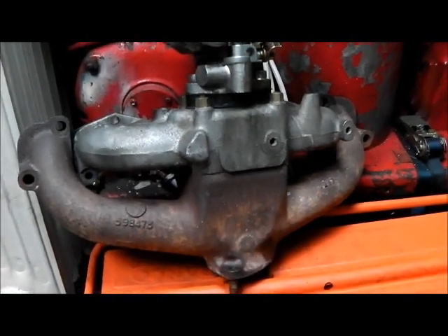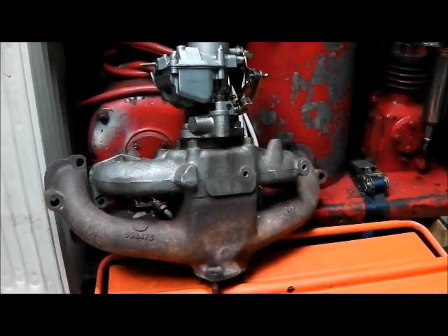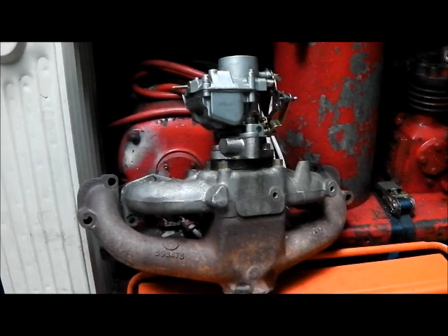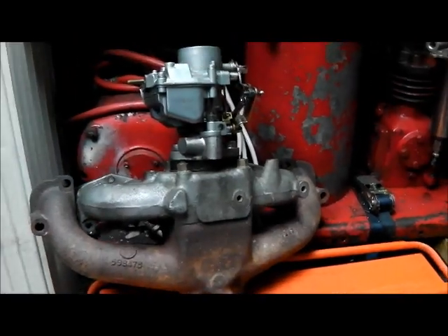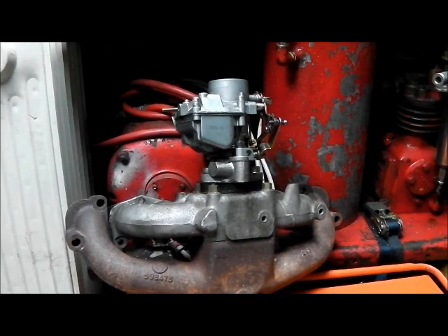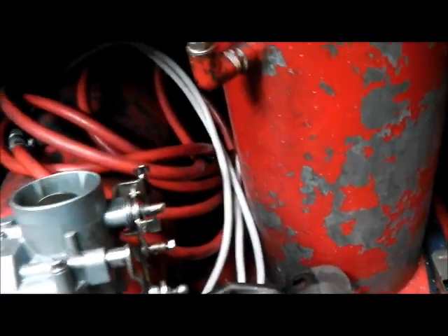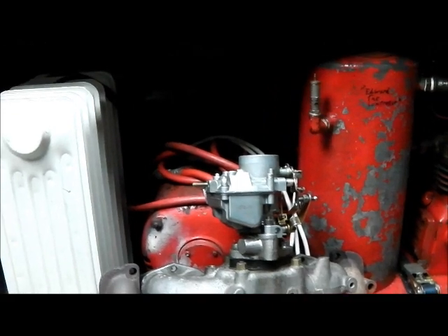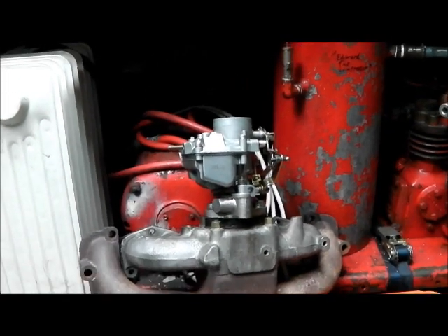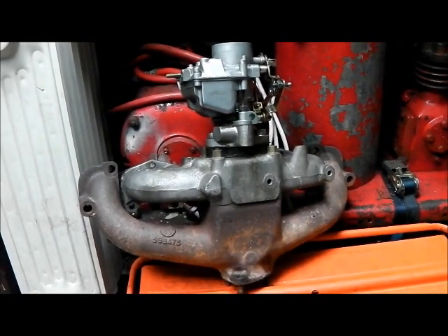Definitely an improvement. Not having the hot spot on the manifold is great. It's going to need the heating line plumbed in because you could see condensation on the outside, so in cold weather that will be an issue — I shall get on and do that next week. Otherwise I'm very impressed. The only difficult bit was the throttle mechanism — there are a few bits you have to cut and alter positions of, and it could do with better diagrams supplied. The choke cable wasn't long enough so I'll have to sort that, and I had to change the vacuum line. But yeah, otherwise it wasn't too problematic really. Anyway, I hope you've enjoyed the video and I'll update you again when the improvements are finally finished.